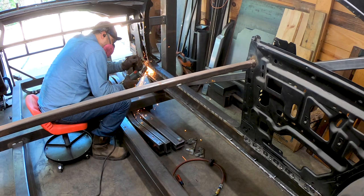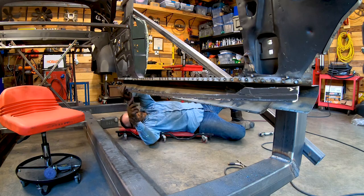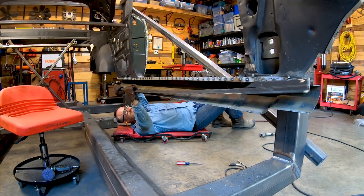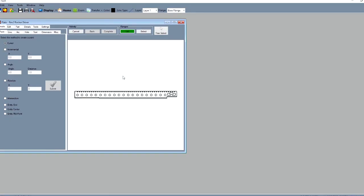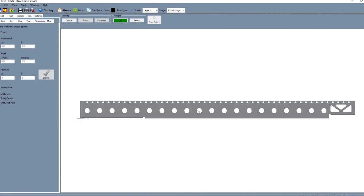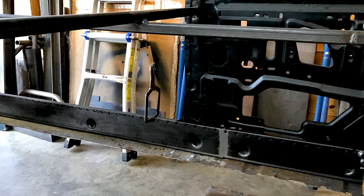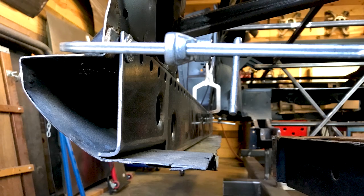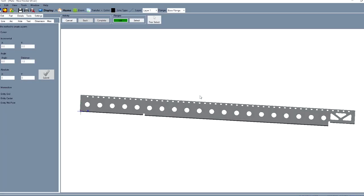Through this cleanup, I reset the whole outer rocker back to the original upper pinch weld and sectioned the lower portion of the rocker to match. Basically, the inner plate needed to be perfectly vertical. That design for the inner rocker plate has had a few versions, not surprisingly. The factory rocker shape has three distinct profiles, and I've measured, sketched, and eventually drawn those in Bentec so my local laser shop could cut and bend them to my specification.